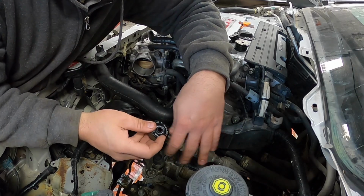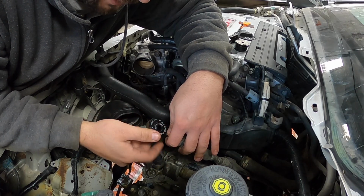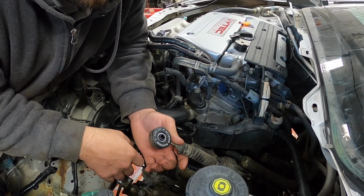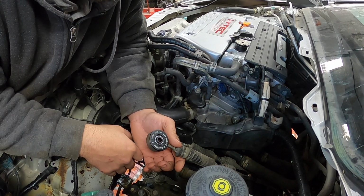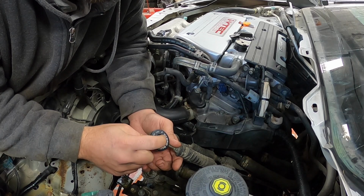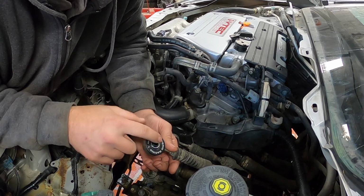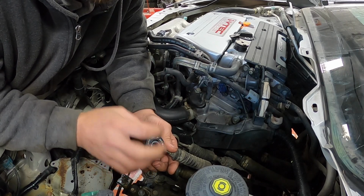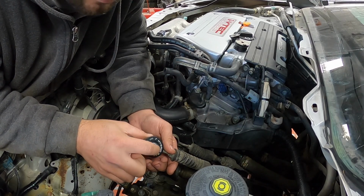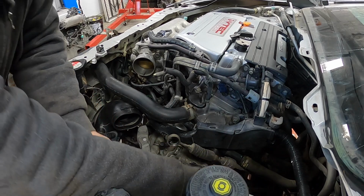Now, I know a lot of people have found my channel from my shifter issue video, which I never meant to be as popular as it was. I was never really trying to call out Acuity. People are saying in the comments it was a shifter cable issue, not a bushing issue, but with that Acuity bushing, you had to really put effort into moving the center collar, which is why I think it caused the bind. Like, look at this thing. It just flops around like nothing. I can do it with my finger. So I still stand by the fact that the Acuity bushing was the root of the problem, whether it was an installer's fault or Acuity's, I don't know. I personally do not have an issue with Acuity. I have an Acuity short shifter in my 9th gen Si, and I absolutely love it. So that's all I've got to say about that.